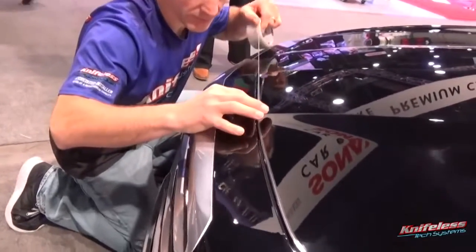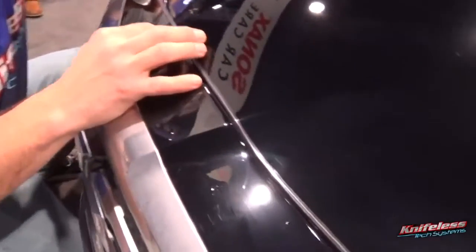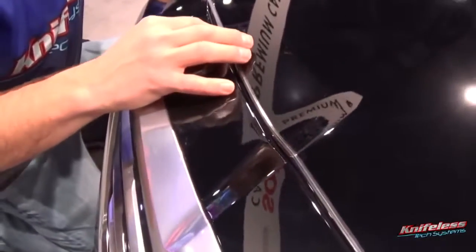So with all paint protection film, you never want to cut to the edge. You want to cut it back a little bit. This is just really good for long-term durability. And here's a good close-up of it. Because the line that is in the PPF line is a wire, and that is perfectly symmetrical left and right. So by lining up this edge to the edge of the hood, it's going to have a perfect symmetrical cut all the way around.